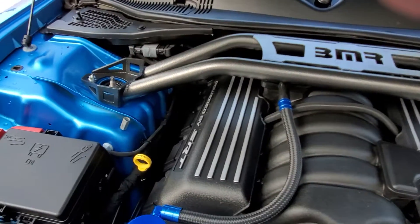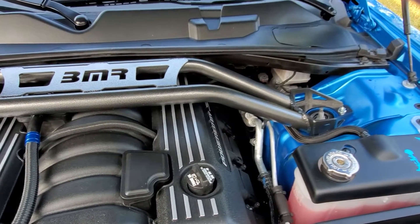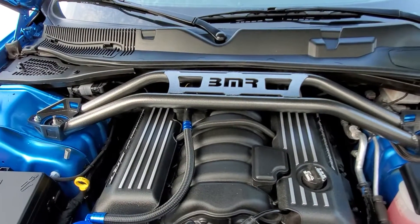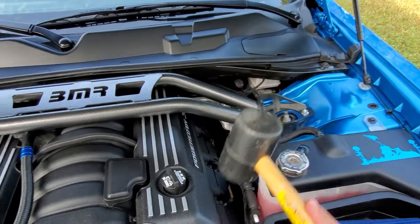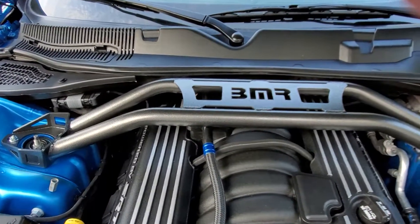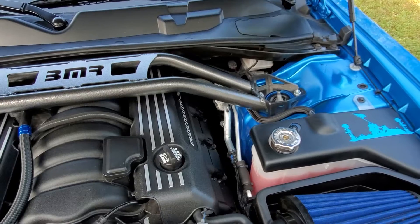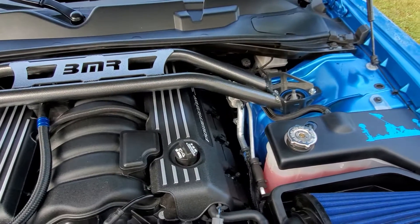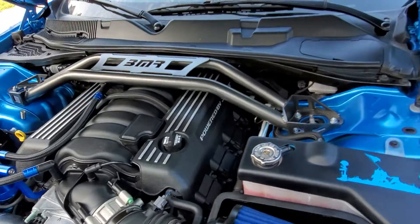My quick tip: unless you want to scratch up your engine bay and have to do touch-up paint like I did, go ahead and get it loosely mounted on both sides, then break out your rubber mallet and give it some slight taps on both sides as you're getting it in. That will force the play to align the bolts on both sides. If you see any water droplets in there, it's from me sweating trying to get these things to align before I finally came up with that idea. A couple quick taps on both sides and it was aligned and ready to go.